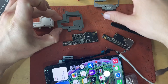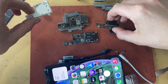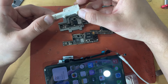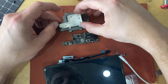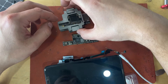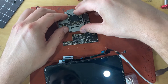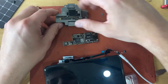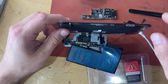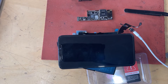What I've got here is a jig. Because it's a big process to solder these two parts together, the jig allows me to test before completely soldering them. You put the bottom in here — it acts as a secondary interposer — so instead of a soldered connection you put the pieces together like this, clamp it, and then you're able to test it. I've got the battery, charge port, and screen connected so I can verify that Wi-Fi and baseband are working.